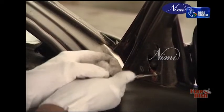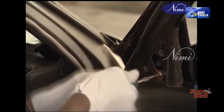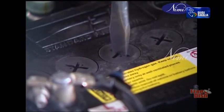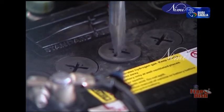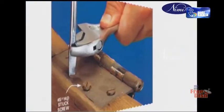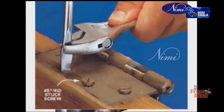and steadily. Keep the tip centered in the slot and the axis of the blade in line with the axis of the screw. To turn large screws, use a screwdriver with a square blade. Apply extra twisting force with the aid of a close-fitting spanner. Never use pliers or toothed wrenches to apply twisting force to a screwdriver.